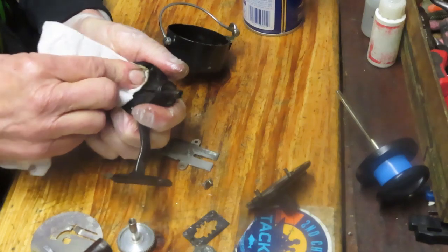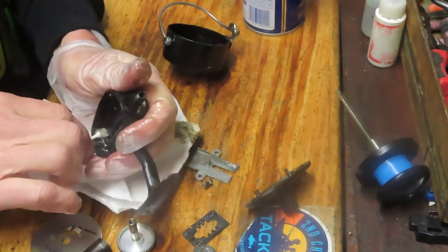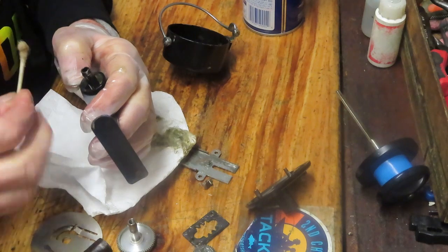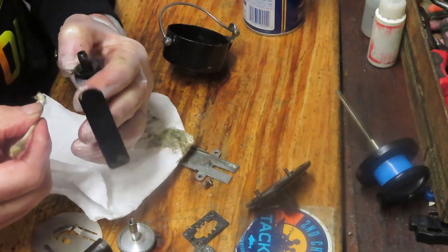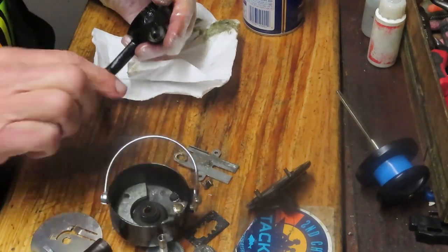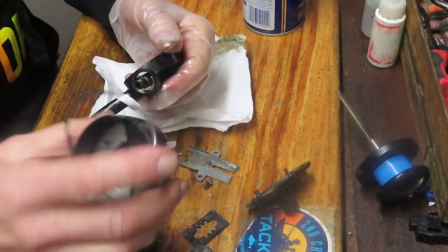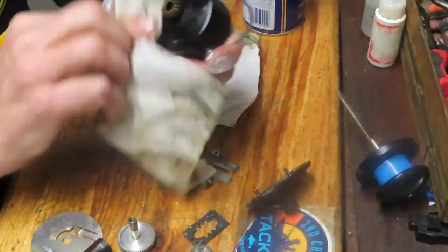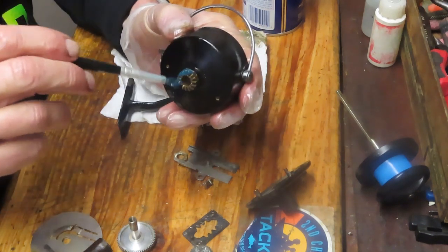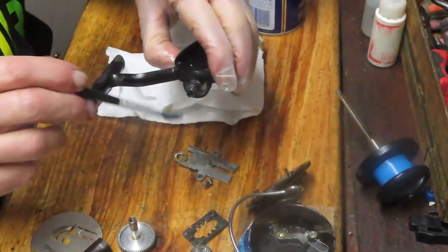As mentioned, you have an arm or washer on the inside of the post, so make sure that's there when you go to reinstall. That's the little washer. Pretty simple — we can just put this right back on. Clean the bottom while you have it open. Check the teeth — these rarely bend, but check them anyway. Grease them up nicely, and also grease the inner shaft that it's going to ride on. Then put your rotor back on.